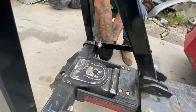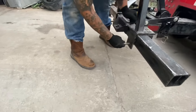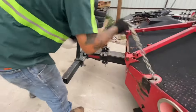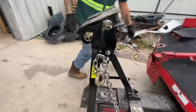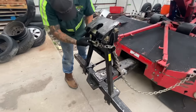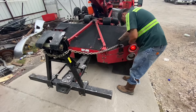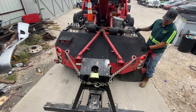Once you get the pins put in and everything's in place, you'll want to take the safety chains that are on board your truck and drape them out there where they're not extremely tight but adjusted in as tight as they can be by hand. Then you can actually take the wheel lift itself — the negative tilt — and push it down. You'll probably want the negative tilt up whenever you install the attachment so that you have room to pull it down and tighten those chains.